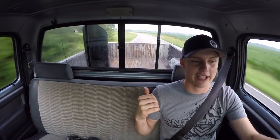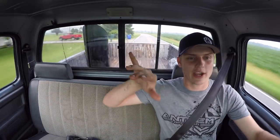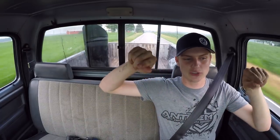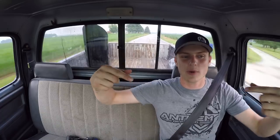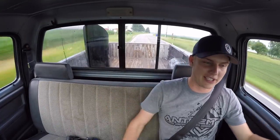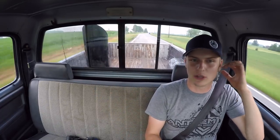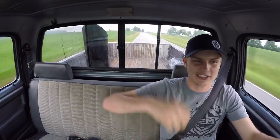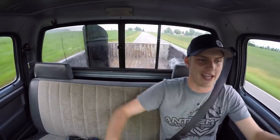Luckily I have some drains in my exhaust already, right where I made that fitting, where it kind of bows down and goes back up. There's two spots where I welded around but left an opening right at the bottom of the exhaust, two really low spots. So it wasn't too bad, but some water did spray up out obviously. Got all around the stack and stuff.